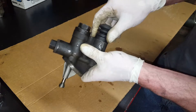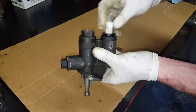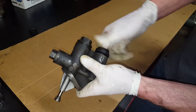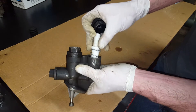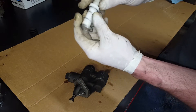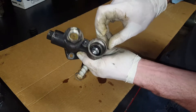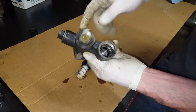Let's go ahead and break this thing down. This is just a rubber protective boot right here. And then there's your plastic plunger. I already got this loose. Popping that out — you got this sleeve here, a tapered spring so they can't go in the wrong way, and then a rubber seal in there. Looks like a double-lip seal, and then it goes right to the high-pressure side of your pump.